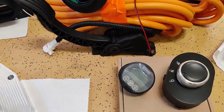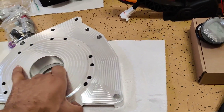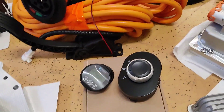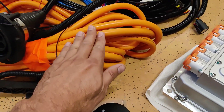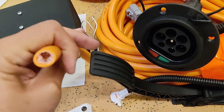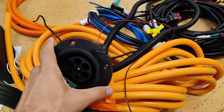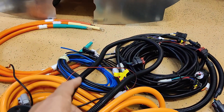All our parts are pre-made to be as simple as possible and very light. For example, the aluminum cover plate is only about three kilos, the motor is 27 kilos, and the battery is 80 kilos — very light parts for the Fiat 500, which is a small and light car. We also provide shielded high-voltage cables in the kit, along with positive and negative wiring, all other wiring for the electric motor, BMS wiring, and similar.